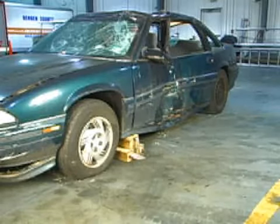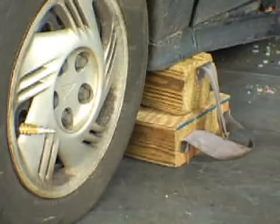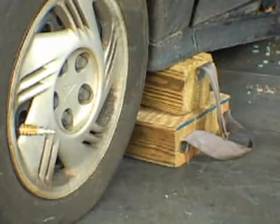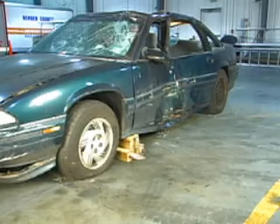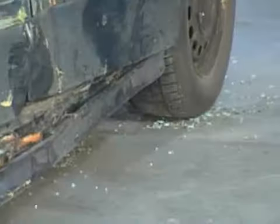Now, as you can see, the car is dropping down onto the cribbing itself, making a platform for us to work off of tool-wise. Now, obviously with stabilization, we're going to need to do it on all 4 corners. So we've done the front. We're going to come in and do the rear corner now in front of the back tire.